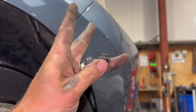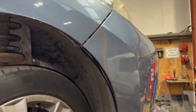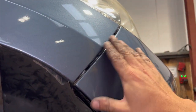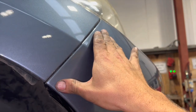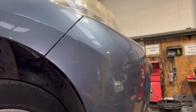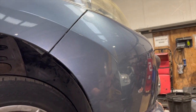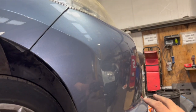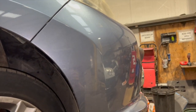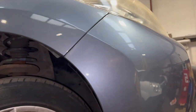Both bolts out on that side. Once you've undone them, give it a little tug and it'll just pop off — I'll leave it in for now and get the other side off. When juggling the bumper off on your own, just pop it off and keep hold while working it around. There are going to be a couple of connectors for the fog lights to undo, and possibly a couple of clips holding wiring as well.